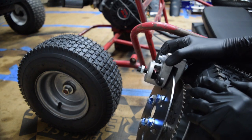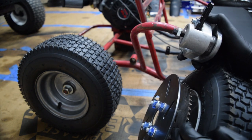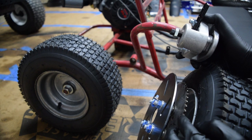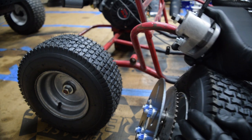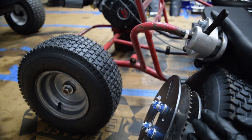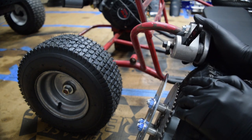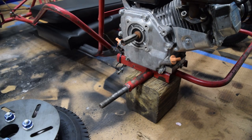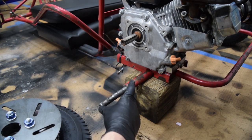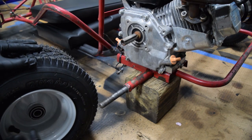It's going to take a bit of finagling to get it all happy and operational. I could in theory use the sprocket as a brake disc, but I don't really like that idea simply because chains have lots of grease on them and it usually cakes up excess grease on the teeth of the sprocket, which means that grease is now getting into the pads. That will eventually cause them to not work all that well. So while it will work, I don't really like the idea of it.